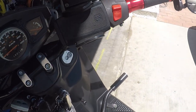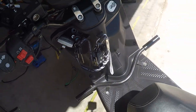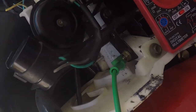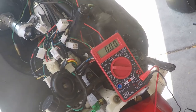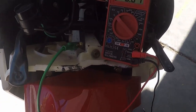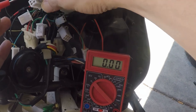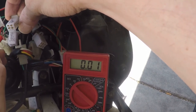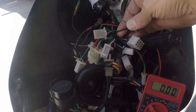We're going to install the voltmeter and tachometer right here. We need to turn the key on. I got this hooked up to a ground on the negative side of the voltmeter. What we're going to want to do is take this side of the voltmeter and test these wires to find one that says 12 volts so we can switch into power — and there we go. This black wire right here is the one we're going to tie into.